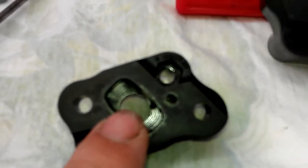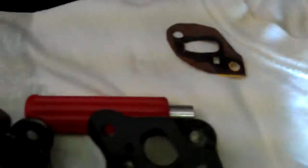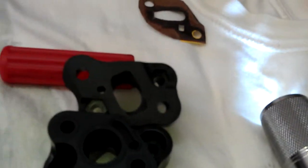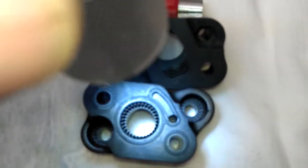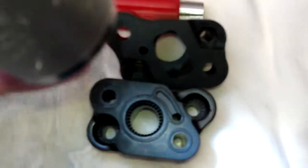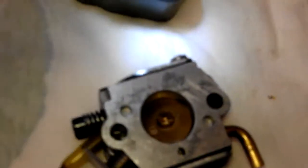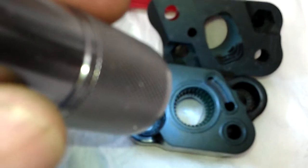There's a good shot — you can see those steps I'm talking about, because those do make a deviation. But it's not that drastic. Whenever I first started on this one here, those teeth — I mean it's insane — you can see how much they opened up. With the flashlight here, you can see the teeth in there real good. You can see that ring here — what I did was measure this to that, and then I used my scribe on this. The carb to the insulator. What it ended up being was the very inside of that outer ring. Your gasket matches on it real well.